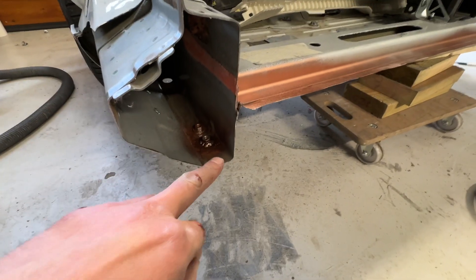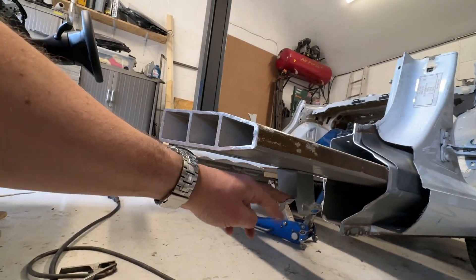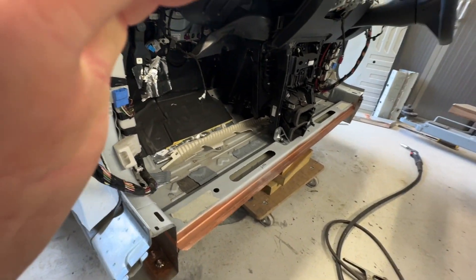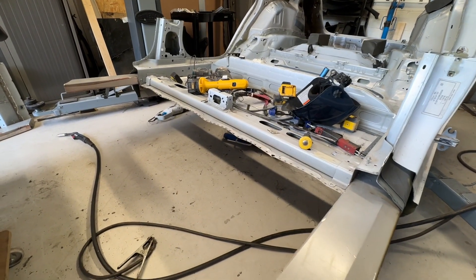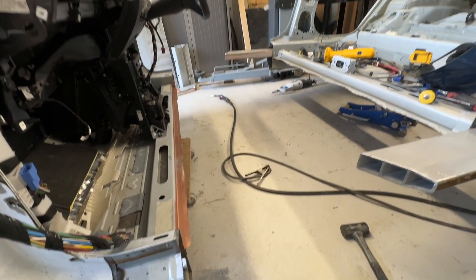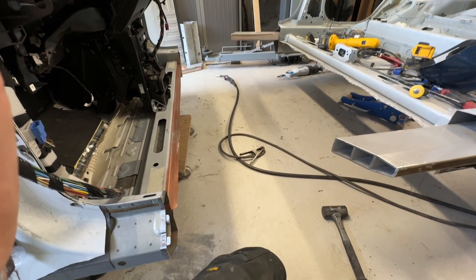In the end I've just welded another flanged nut in there — that's because of the change in spacing with the shortening. I've riveted on these brackets and then I'll re-plug weld them in afterwards under there. The floor pan flange is all L3 primed, and I've joggled this flat. It's a bit wobbly because of these pressings but I'll straighten it out as it goes down. First job is to get these side rails slid back in and just double check the length and square and straightness, then I'll weld it up. I'll probably put some strengthening plates on the outside afterwards because it's all going to be hidden anyway.